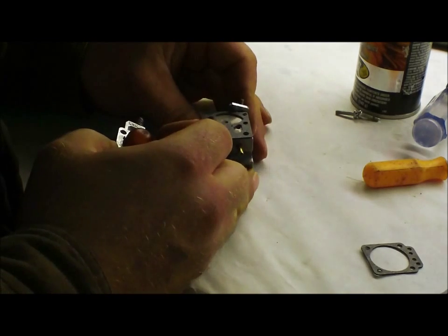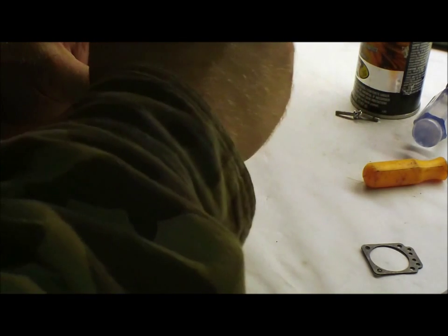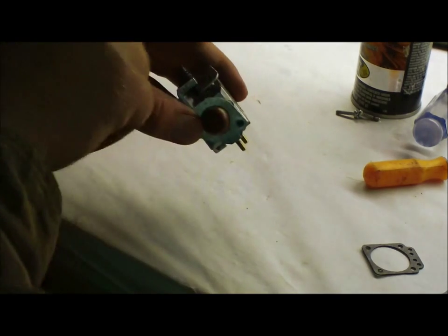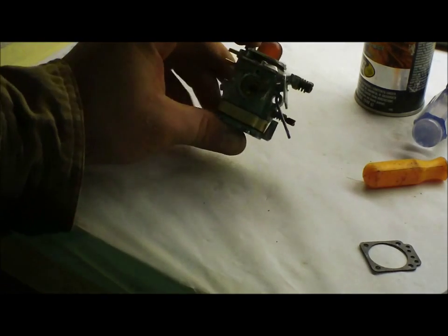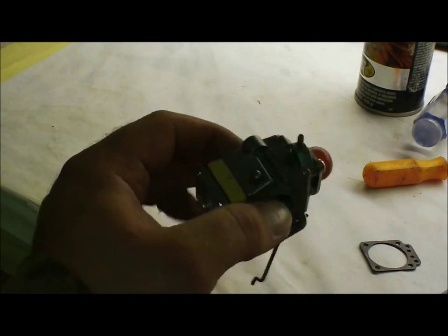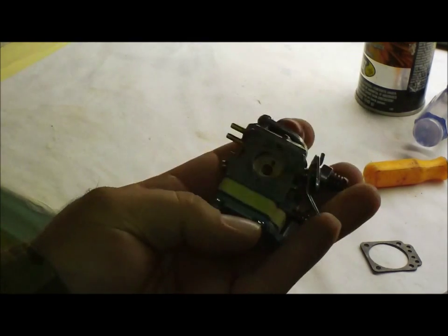And then you can put on this cover now. It's a little tricky. You've got to hold the throttle slightly open as you put the cover back on because the idle set screw has to hit that little throttle. So you just got to hold that out of the way, or you could back your idle all the way out. And you put in your two screws in the top. And there you go — she's all back together with brand new internals, all nice and clean, ready to rock and roll. I'm going to get a smaller screwdriver and tighten them up because the number two doesn't really like those tiny screws.